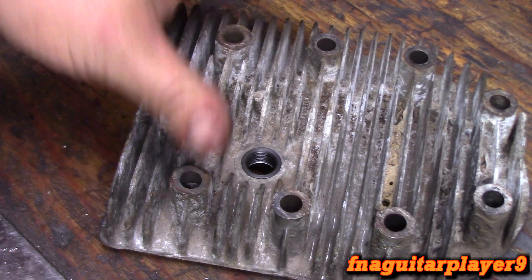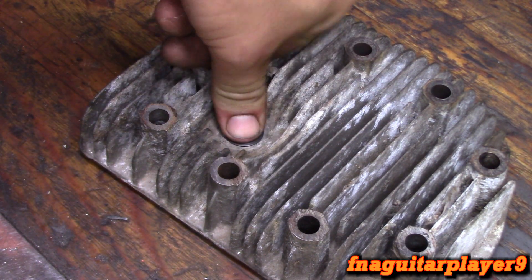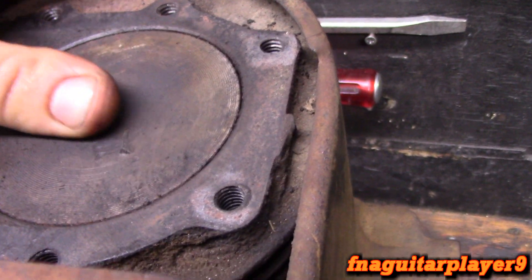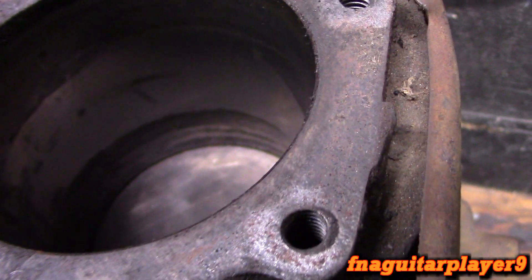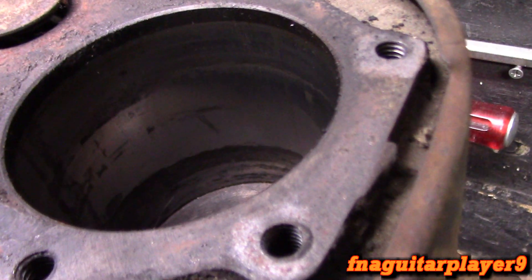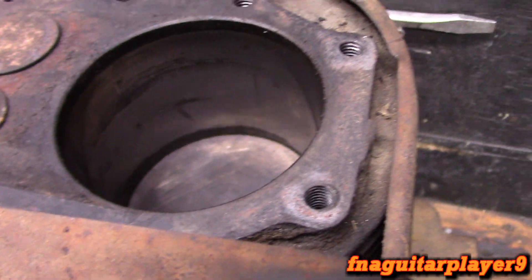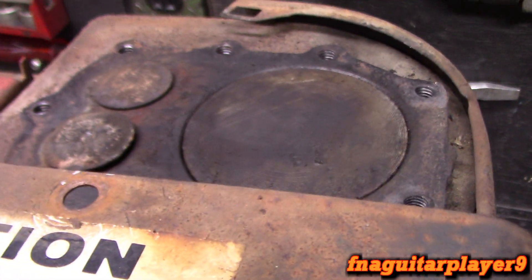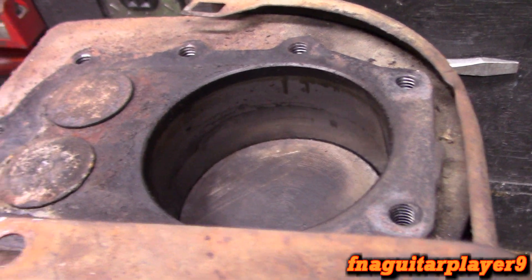That part of the video is done. If that's all you need, you can end here — but if you want to see if we can get this motor running, feel free to hang in. I figured this engine is going to need a rebuild. It's got a lot of play on the piston — a little is normal, but this is excessive. The cylinder doesn't look as bad as I expected, but it's got some pitting and wear marks. I'm figuring this is going to be an oil burner. I'm planning on rebuilding it at some point, but right now I'll put a little oil in the cylinder to keep it from starting dry.